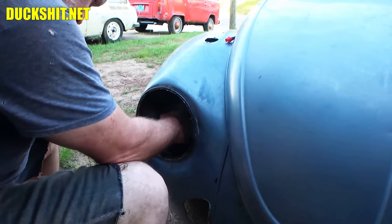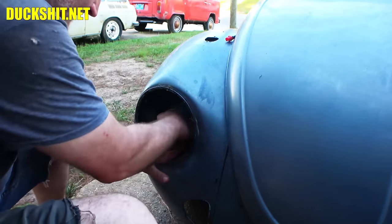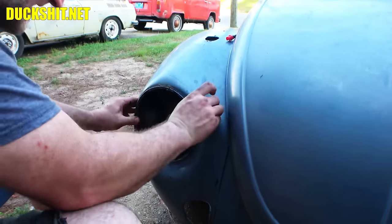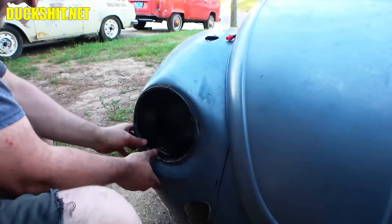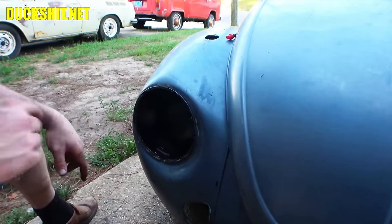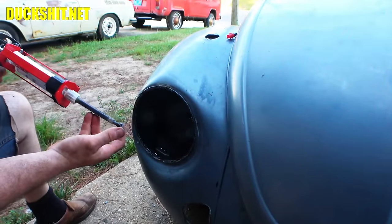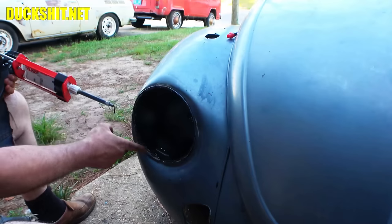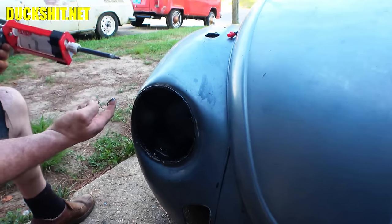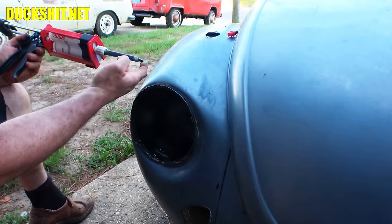All right, gently press this in. It just needs to go far enough. I think that actually gets it right there. We'll just smear a little around the edge there just to make sure we get a good closing up properly. I mean, this is not a seam sealer. In fact, this is much more expensive than a seam sealer is, so don't start using it as a seam sealer. But I'm just trying to get the adhesion of these two panels together here.